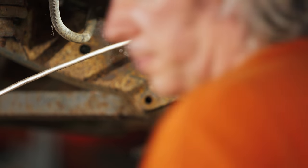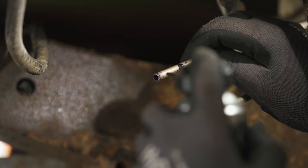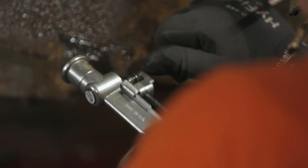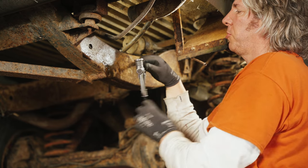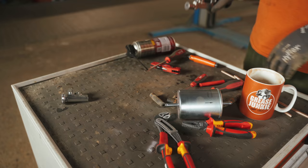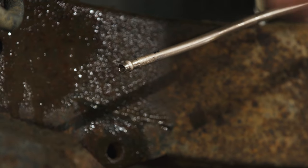Now I do the other one. The trick is to do really gentle, gradual compressions — winding the screw in very gently, stretching the metal each time you go around. So now I've got a bead on both of my pipes.